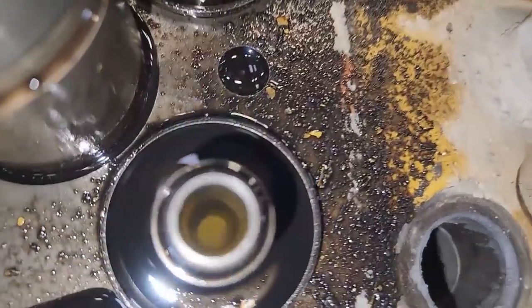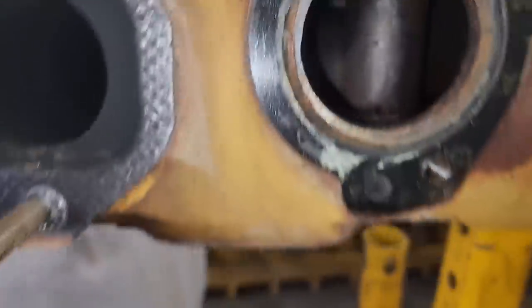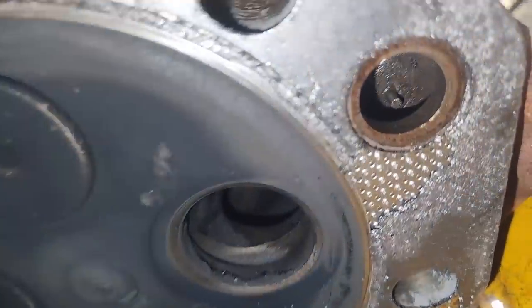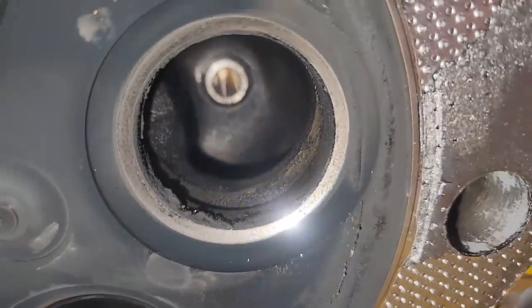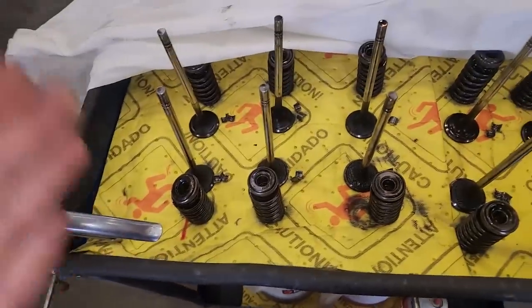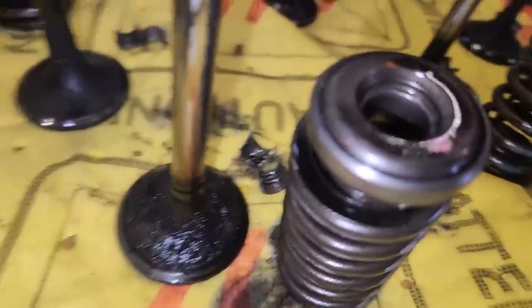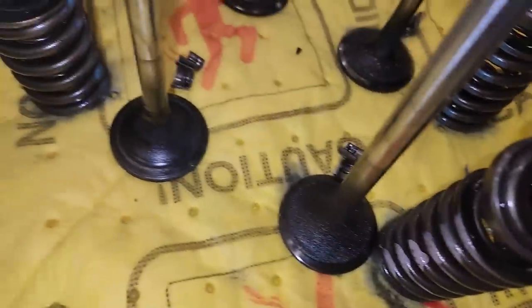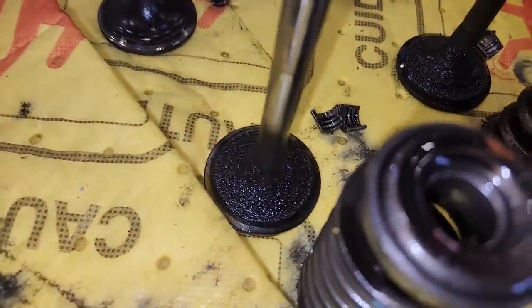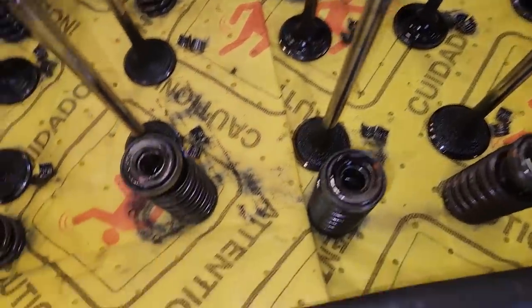I pulled the intake valves out to take a look. The valve guides show no excessive wear or damage. The valves and valve guides appear to be in good condition. I spent quite a bit of time researching in CAT whether you can install valve seals to help with heavier oil consumption, but I could not find any special service letters indicating that. There is quite a bit of burned oil residue on the valves, so oil has been getting on these — but is that the cause of the oil consumption? Really no way to tell. It's probably going to be on someone higher up in the chain to decide what gets done, and as it sits now, this is where it stays until the next video.